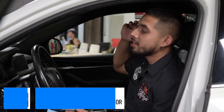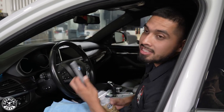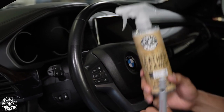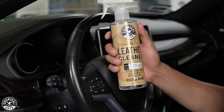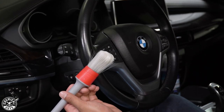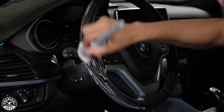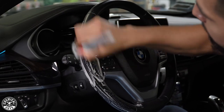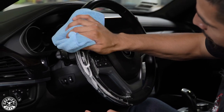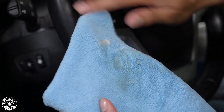Now for tip number five, we're going to be moving on to the interior. We're going to start off with the steering wheel. As you guys can see, the BMW steering wheel is leather, and you can already see a 50-50 from one side to the other — this side has body oils, maybe has sunscreen, who knows. I'll show you guys how to restore your leather back to how it's supposed to look using Leather Cleaner and the All In The Detail brushes for the interior. The nylon bristles are very soft. Spray some Leather Cleaner onto the bristles, start agitating the area, and it's going to break down any body oils, sunscreen, or Dorito fingers stuck on your steering wheel. Once you're done scrubbing, get a clean microfiber towel, wipe it off, and you can see all of that is just built-up grime and debris.